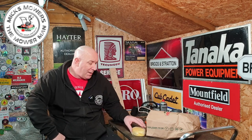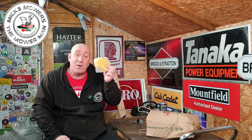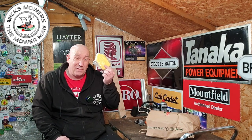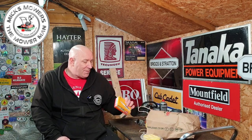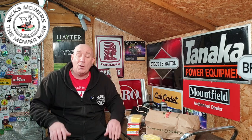Now's the time to get your machine serviced ready for the season. I've just bought online some cheap copy Briggs & Stratton foam filters — I don't buy the genuine ones because it's just not worth it, it's just a foam filter. You can get those for less than about 70p each. I've picked up a box of 10 ES spark plugs, a box of 10 B2LM spark plugs, and I've got my range of oil. I've got my sharpening flappy disc ready for sharpening blades, and loads of pull cord — I buy it in 100m lengths.